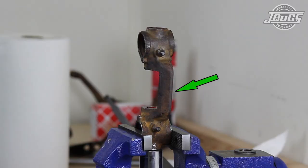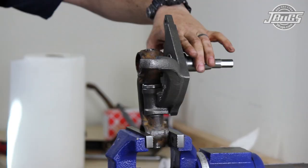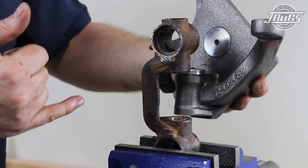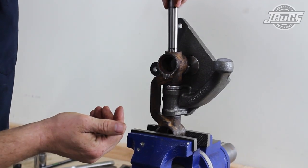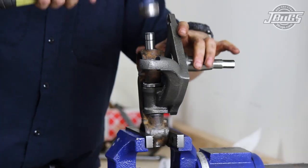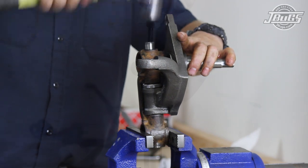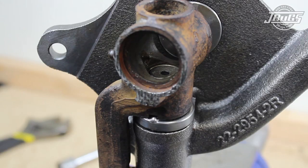The angle on the brace for the carrier has a flat side and an angled side — the flat side sits towards the chassis and the angled side sits towards the spindle, with the steering arm for the spindle at the opposite side of the carrier brace. Grease is applied to the upper and lower bushings and the spindle is slid into the carrier following the notches in the carrier. A new greased king pin is dropped through the top hole in the carrier and, with the spindle straight in the carrier, the grease ports are aligned with the holes pointing forward. The pin is tapped with a good amount of force into place through the upper carrier, into the spindle and the lower carrier, until it is roughly flush with the upper king pin bushing.